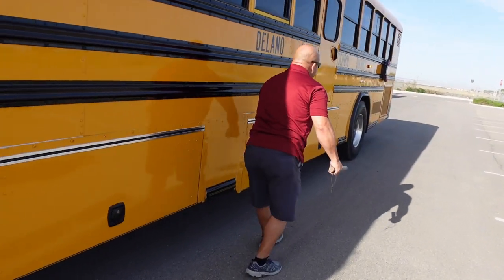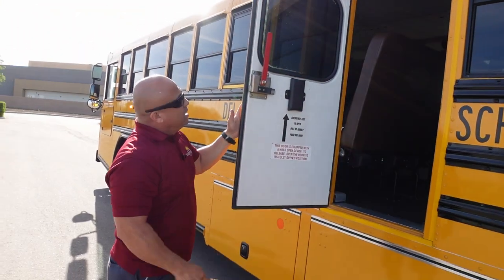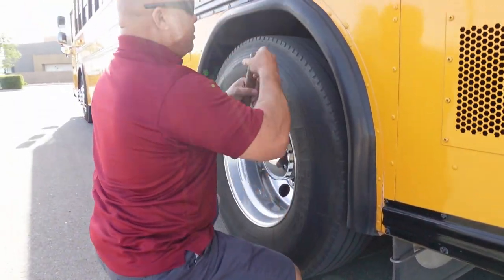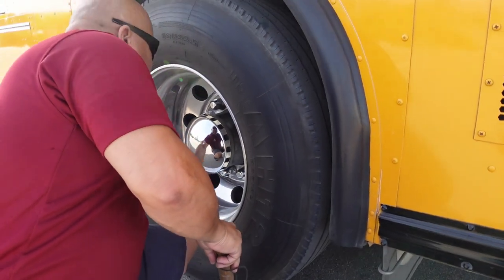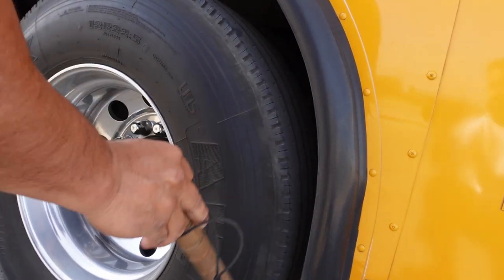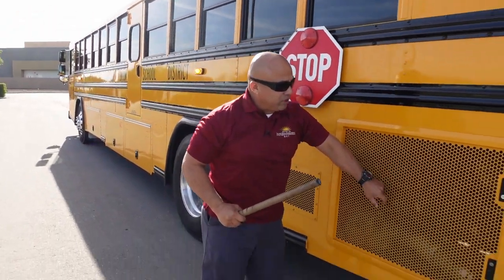Panels are secure. Reflector is intact. Emergency exits, Delano Union School District, CA number — all labeled properly. My arrow is going up, so I'm going to lift my handle up, making sure my door is working properly, that it locks in place and my sill is intact. Checking my wheel well cover — secure. Checking for proper inflation. Tread depth minimum in the rear should be no less than 2/32 of an inch in all major grooves. No cracks or bubbles, rips or tears in my tire. Checking for loose lug nuts — indication would be cracks or rust; there's no cracks or rust. No cracks, dents, or illegal welds in my wheel. Valve stem is secure. Mud flap is secure. I have a visual on my drive shaft guard and a visual on my leaf springs front and back. Checking for foreign objects in my tires and in between my tires. My stop arm is secure. Panel is secure. Reflector is intact.